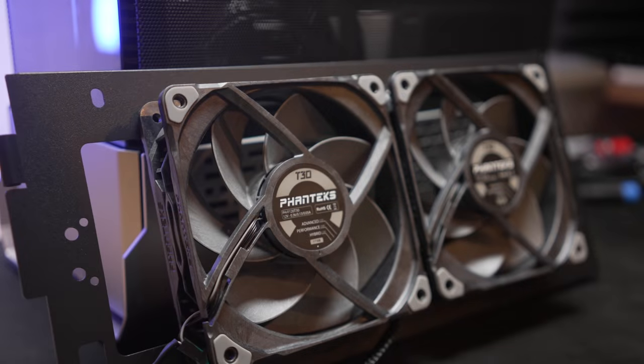Comparing to the Q58 again, the Shift XT does appear to be a step behind. In the medium configuration I tried a few things to investigate the heavier GPU temps — even taking the air filters out to see if they were too restrictive, but that wasn't the answer. Even with a more open air intake path, the case fans don't help the GPU anymore because they're just drawing air from right next to them. I also tried pulling the power plug out and using extension cables to push the riser cable and fit a Founders Edition card — even then, thermals were still fairly average. For the combined stress test with CPU at a slightly lower clock, GPU temps are similar to the gaming scenario, and either of the two larger configurations will be a safer bet with high-powered graphics cards.